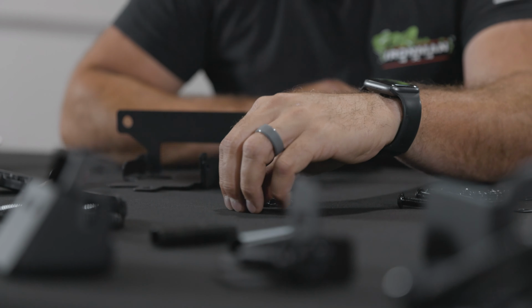And to get the parking sensors out, you just push down on the bottom tab, kind of pull up on the back of the sensor, pry both halves apart, and kind of clamshell open. Just wiggle them right out. Well, that side's done. I'm gonna call this RO for right outside. This will be RI for right inside, and left outside.